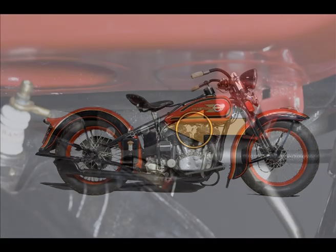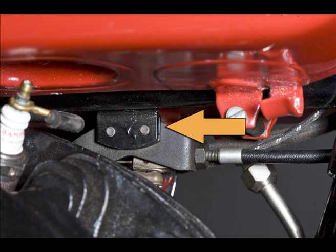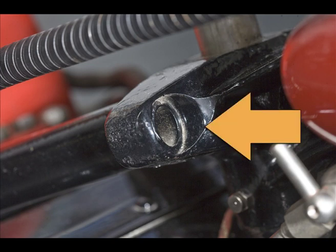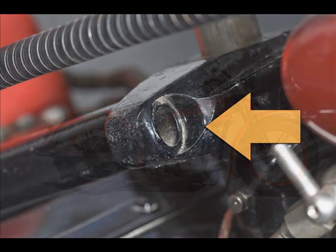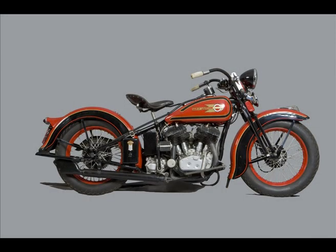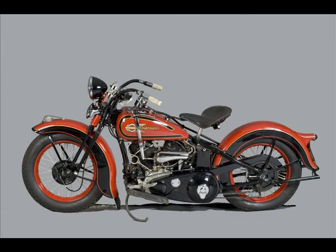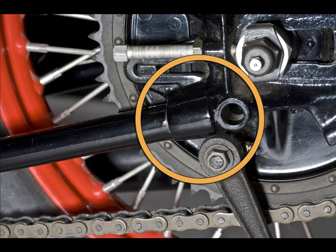This tab under the tanks that carries the control bracket was introduced in 1932. This sidecar lug was altered from straight cut to countersunk probably around the beginning of 1933. The toolbox was moved from the front forks to the rear right-hand side in 1935, needing this bracket to mount it. And finally, this lug to carry the four-pipe exhaust from 1929 was finally removed at the back end of the 1934 season at around engine number 6500.